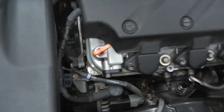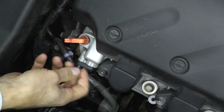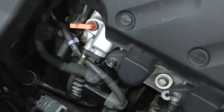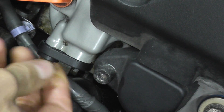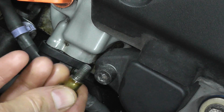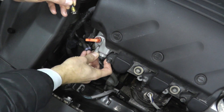This is something we need to look at. Fortunately it's simple enough — just a 10 millimeter fastener. Look at the fastener — let me zoom in here — you can just see all of the oil. The o-rings look like they've failed. Look at that — and then this just comes right out.